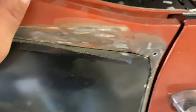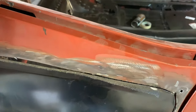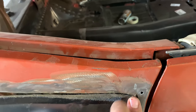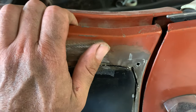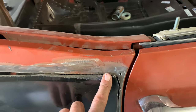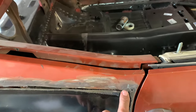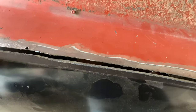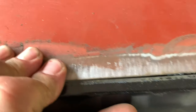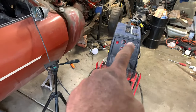Got it all cut apart, tape peeled back — looking pretty good. I like that gap; it leaves someplace for the wire to go, and someone told me that a long time ago and I can't agree more. You can actually keep the heat a little bit less and still get full penetration of the metal — that's just my technique. When we're all squared away I buff it nice and smooth, keeping the heat down. That's probably the most important trick and the key to this whole thing. When it's all done, if you were to sandblast this car you'd almost make that seam undetectable from the outside and the inside. I can push on it and control the gap for a nice clean line — I'm going to start butt welding that. Unfortunately I need to go refill my tank — some moron left it on again. Actually this time I just ran out, so I need to go get a tank exchange.